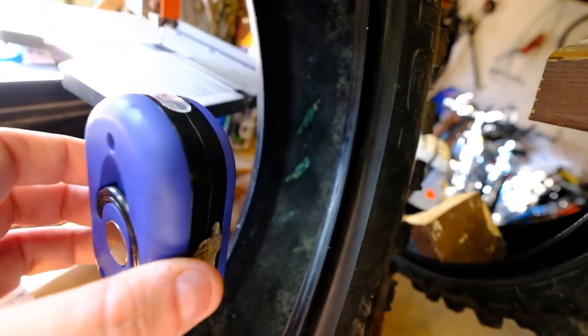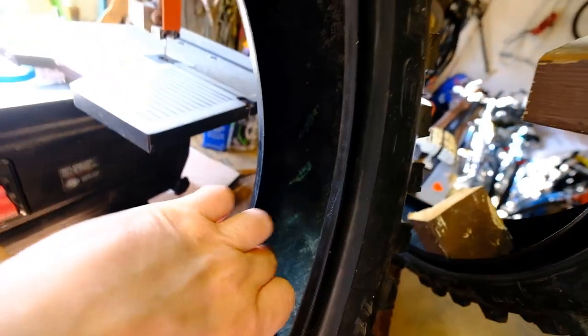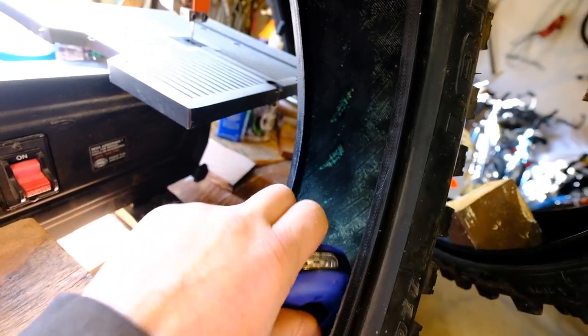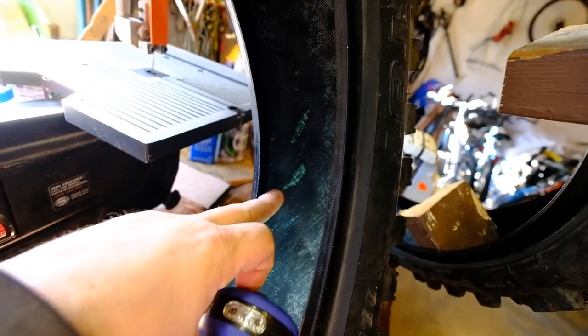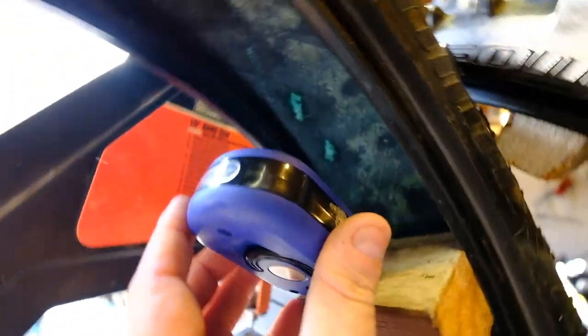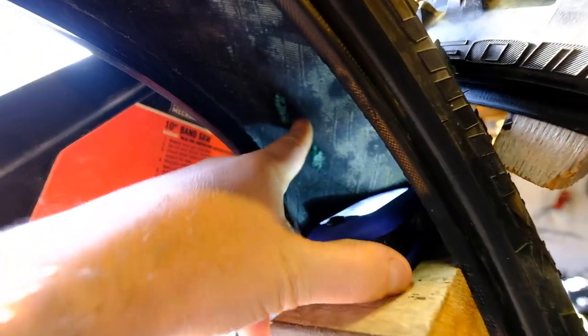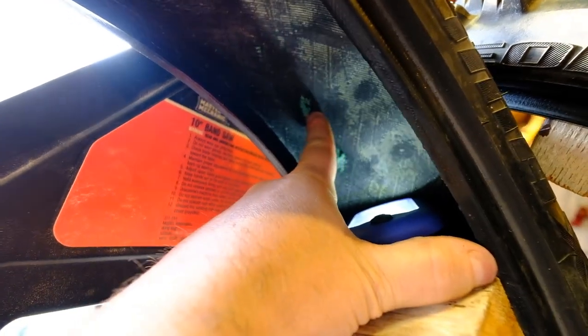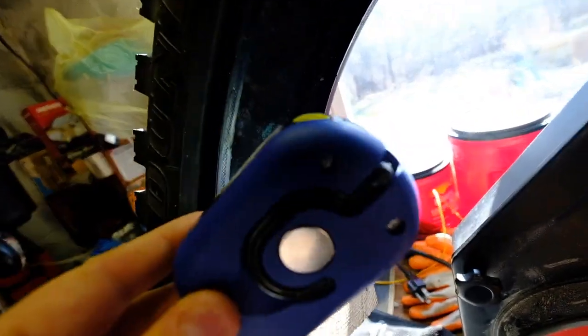It's on both sides of the tire inside. This is roughly a good finger's width in from the inside of the tire — it's not at the bead area. This is where the slime is sitting when it's rotating in your tires. It's literally eating through the tire — see if I can stack this on here so you guys can see that. The rubber is now super soft, and it's all on the inside.